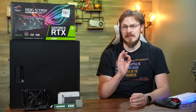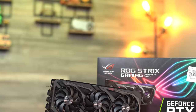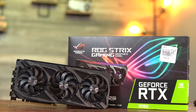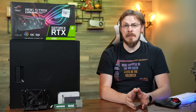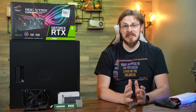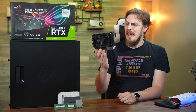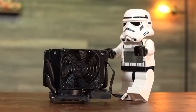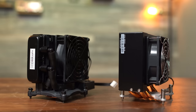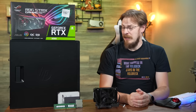As I wanted this build to be a little bit of a workstation and a little bit of a gaming PC, I opted for the RTX 3060 12GB — the ASUS ROG Strix GPU — and a huge shoutout to Micro Center for sending this over. While the 3060 Ti would make more sense for a pure gaming PC, I wanted the 12GB of GDDR6 for video editing and high-intensive video workloads. I also tossed in one optional part I've never tried before: a stock all-in-one liquid cooler made for the HP Z840 workstation that mounts right up to the Z440. It did come with a 120mm tower cooler, but it's a tiny self-contained liquid cooler — I had to try it out. And with all the introductions out of the way, let's get this thing together.